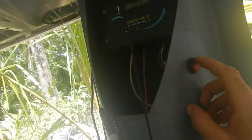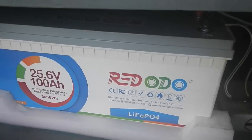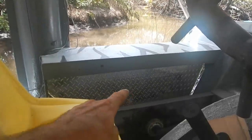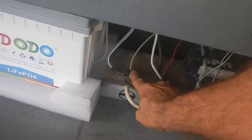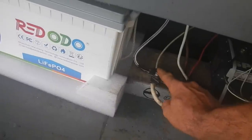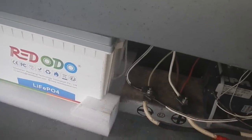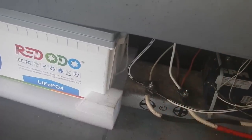Got it in there — that's going to be nice. Cover off, there's my nice fancy batteries. There's one in this compartment here and one in that compartment over there, and they're connected to each other electrically. I set up electrical bus posts so all my negatives are connected at one point and all my positives are connected at another. That's going to make it super easy to connect this lighting — I just have to take off the nuts and connect my negative and positive.